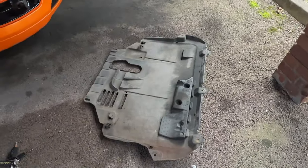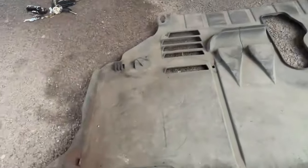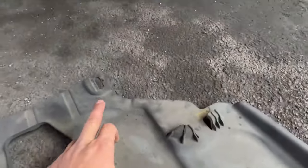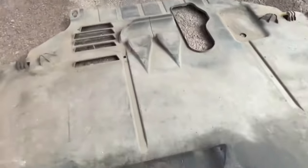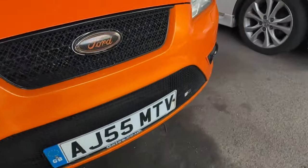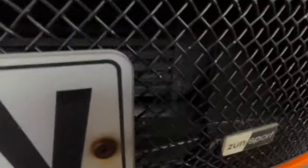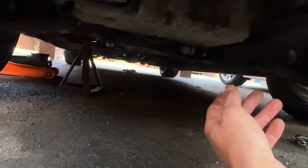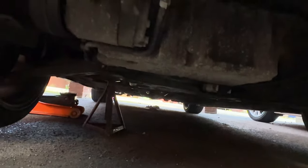And we're off. There was a bolt either side — one there, one there — and obviously the two at the back. It's good to see it's all dry under here, so the car definitely hasn't got any old leaks. If a car's got any sort of leaks, the under tray catches it and you don't know. But yeah, looks all right under here. It looks like it's had a rear engine mount at some point, so it looks really clean.